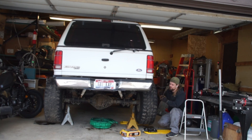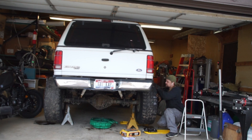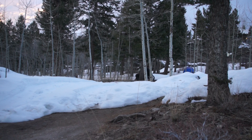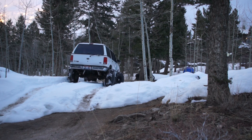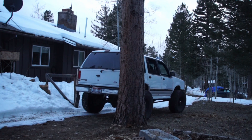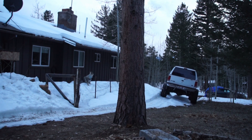That was a whole bunch of work just so that now when I turn this tire, that one also moves in the same direction. Notice that it will ratchet when you need to go around a turn. But in general, they move together. Let's test this thing again. I came at this snow pile in two-wheel drive because I wanted to see how well the locker would do on its own without the front, and I did get stuck pretty quick, but you can see at least that the locker is doing its job. Both rear tires were spinning. You can see the difference between the locked rear and the open front — the front only has one tire spinning even though the rear had both. As soon as I put it in four-wheel drive, it pulled right through. The Explorer is now three-wheel drive and can clearly handle driving around my backyard without getting stuck.